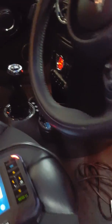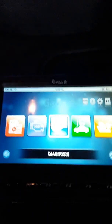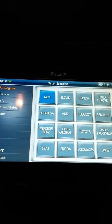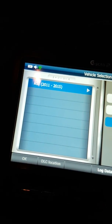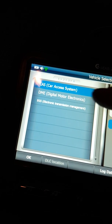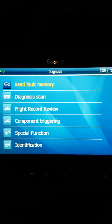The car was misfiring — I've fixed it now — but I just want to show you a quick guide on how to find the fault. The car is running and it's not always that the engine light comes on. Anyway, in this case you go into diagnostics on g-scan, find Mini in there, go to Coupe, this one was 2011, then select Drive and Digital Motor Electronics, press OK.